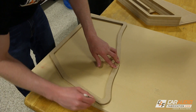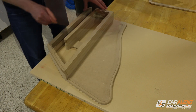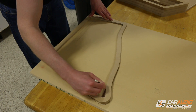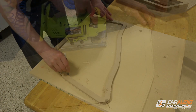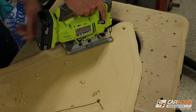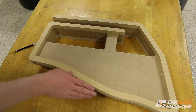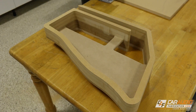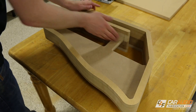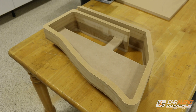The next layer I needed to create was once again a new profile — in this case it consisted of the port wall itself as well as the large overall profile. I wanted to make sure this next layer was absolutely perfect, so I started with rough cutting before doing more work on the router with the flush trim bit. Here's a visual recap of where we're at profile-wise. For the next six layers the profile was the same, so it was time to crank up some jams and really just go nuts on the router.